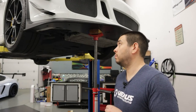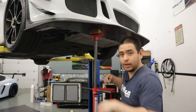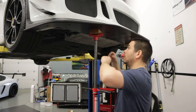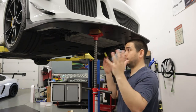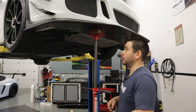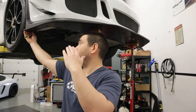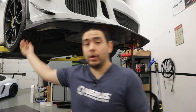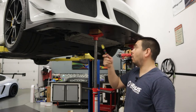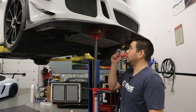With the bumper temporarily reinstalled using the pull tabs — which do a great job of holding the bumper without any bolts — set the splitter up on pole jacks or a floor jack, or flip the bumper over on a blanket on the ground. Center the splitter to the bumper, make sure the gaps are at the end of the splitter, it's flush with the plastic cladding on both sides, and that the splitter is centered side-to-side. Then mark every single hole that goes to the bumper.